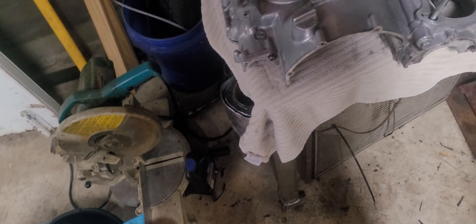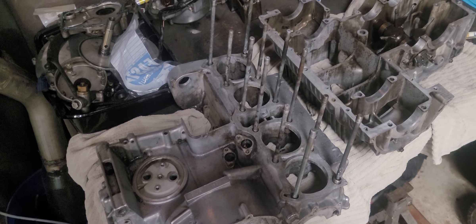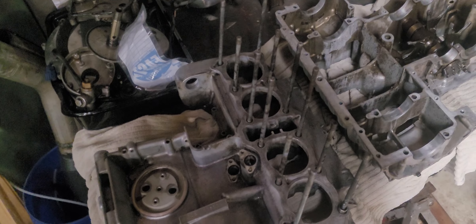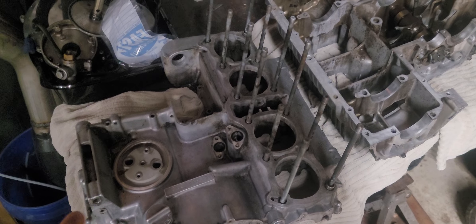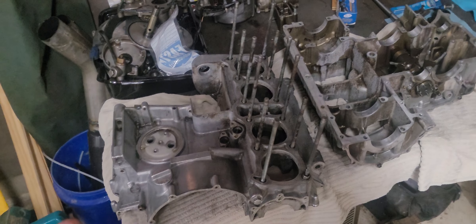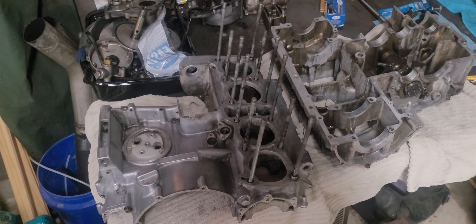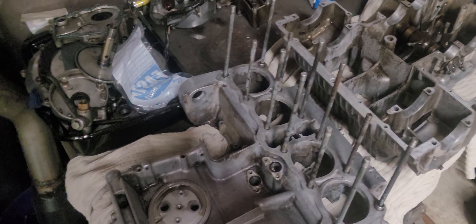The reason I wanted to look at that oil pump is this engine would turn on the oil light at high RPM — say third or fourth gear. I suspected the pickup screen was going to be restricted, basically starving it for oil under a high-volume situation. But what actually makes the most sense to me now is it was sucking the oil pan dry, which is a somewhat common thing on these. A lot of guys run the oil level a little bit high to prevent that. If the oil light doesn't come on after that, we'll know that was the problem.